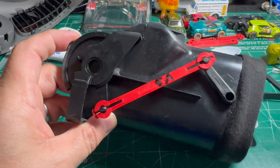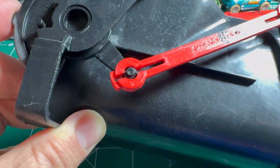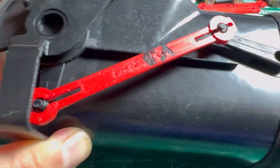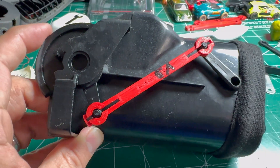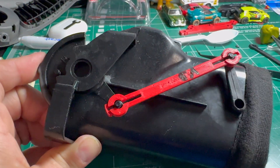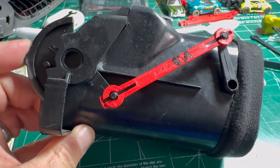So there we go. You can see there are two pivot points, and the problem I was having in version 2 was that the inside of the mating surface was not rounded or concave, so the ball joint had nowhere to go and just popped out. But now you can see it's working great. The other one — I can't even find the part. Pepper was in an accident and I have a feeling that impact caused all of this to jar that thing loose and pop this thing loose. But there's the part — pretty cool. Now I can weld all of this back together using the stapler.